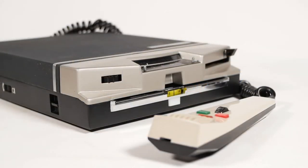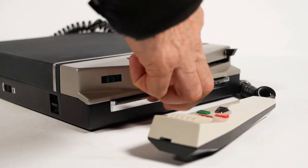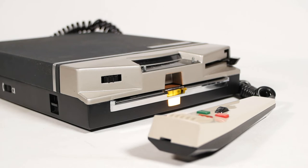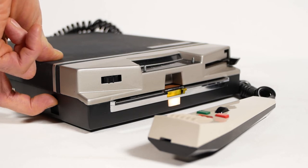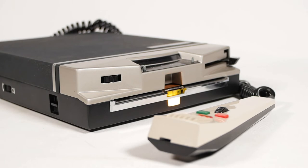Next, I think we can try some recording ourselves. So I'll put in another disc and lower the playhead, which also switches the motor on. And then I'll pull the lever to erase anything already on the disc. You'll notice that the machine automatically spins the disc when you use this lever. And now we're ready to record. So, start it playing and press record. When I first tried the machine, it wouldn't latch in the record position — it would only record while you were holding the red button down. That was just about okay for dictation, but not so good if you were planning to leave the microphone in the middle of the room to record a bunch of people. Additionally, the record light wasn't working. It turns out that the bulb had blown, and it forms part of the circuit that latches the machine into record mode. So simply replacing the bulb fixed the problem.